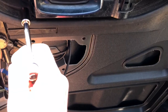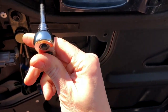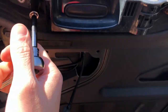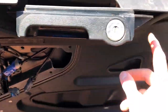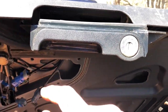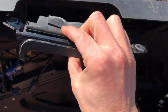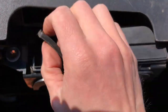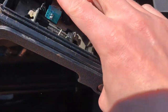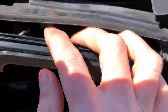The next thing we're going to do is undo the lock assembly. This requires a metric 10 socket — you're simply going to take out one bolt on each side. I said bolt previously, but nut is the correct term. I've taken out the two metric 10 nuts and yanked on this assembly a little bit, which reveals this rubber gasket. We'll go ahead and lift that off.